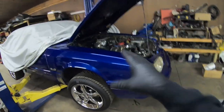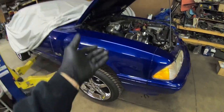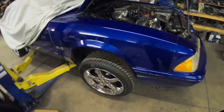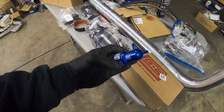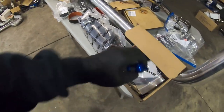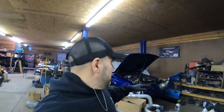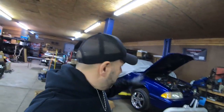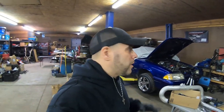Make sure you check out my upcoming videos — we're going to do a first drive with a wideband, heading over to the dyno to see how much boost it makes, and we're going to hook up the Grimmspeed for the wastegate. I'm excited because this is the type of experimental stuff I love to do. How much power can a speed density turbo car with 19-pound injectors make with a simple FMU? We're about to find out.